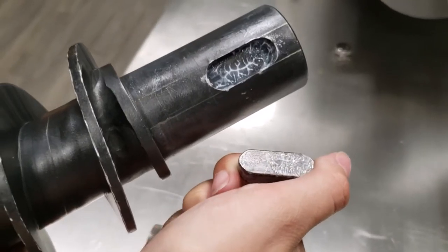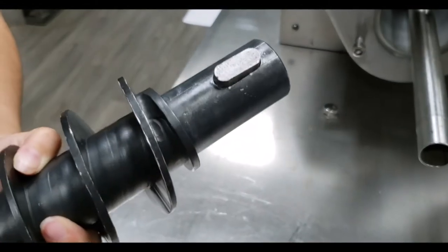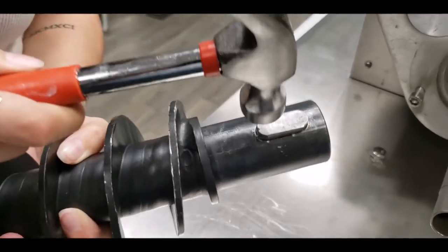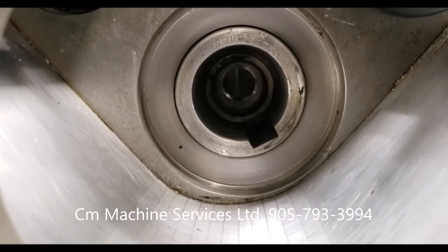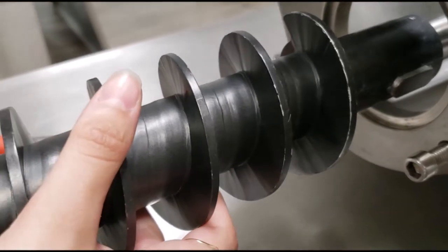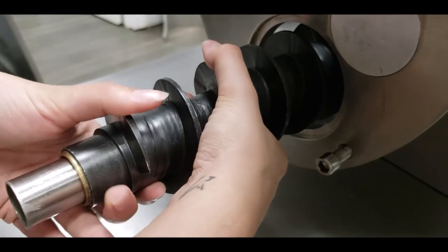Now we're going to put in the screw, and at the same time keep in mind you need to put the keyway back on. It's also a good idea to add some food grease so that the keyway stays on there, and it helps when removing and putting it back on. If you find that your keyway is not on there properly, you can give it a tap with a little hammer. Now it's ready to insert into the machine — the hammer also comes with the kit. As you can see inside the chamber, that is the path of the keyway when inserting the black screw. Now we are inserting the screw and aligning the keyway with its slot. Once it's in, it very gently falls into place — no need to struggle.